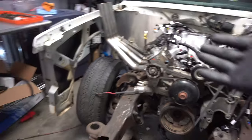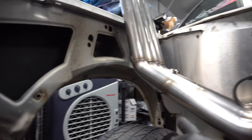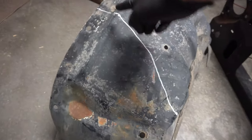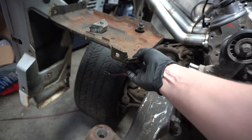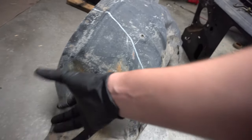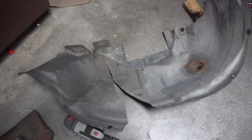We want to get all this stuff mounted and mocked up. Once we're done up front we can measure for radiator hoses, get everything plumbed to the radiator, then finish out the front end and work on wiring the fans and the EFI. I'm going to retain the battery bolt right here — cut just a little past it, draw an angle down, and keep the battery mount in this area. I'll cut here, get rid of all that, retain this portion, and bolt it in.